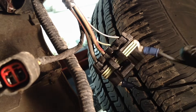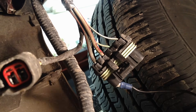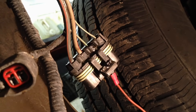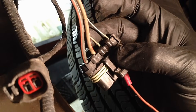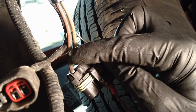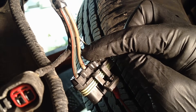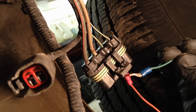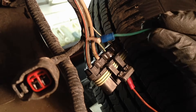Next we need to test the two small wires going into the relay to make sure the relay is actually being commanded on. We're going to test the small constant ground for the control part of the solid state relay — that's the light green with red wire, right here in the middle. Then we're going to jumper it to the light blue and red wire, which is constantly hot, and use that as our positive. This tests that ground for its load-carrying capability.